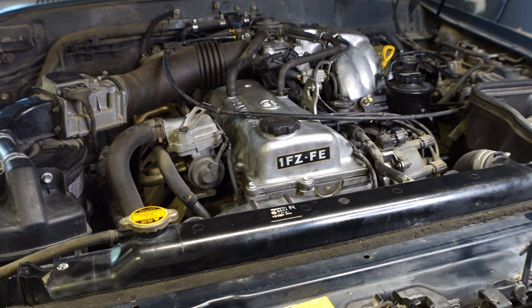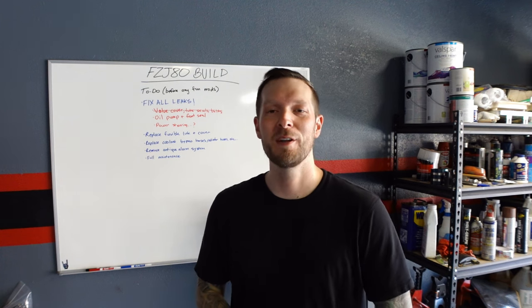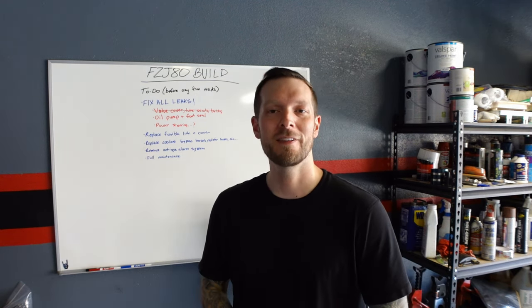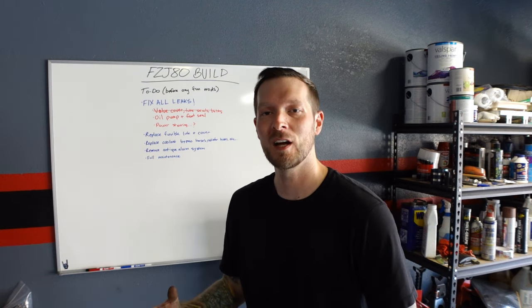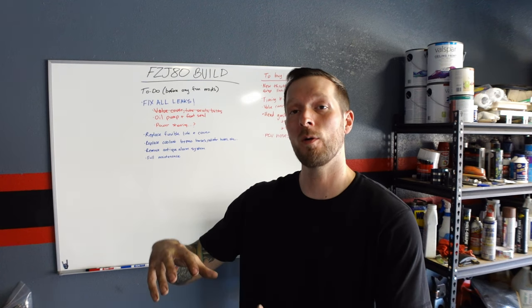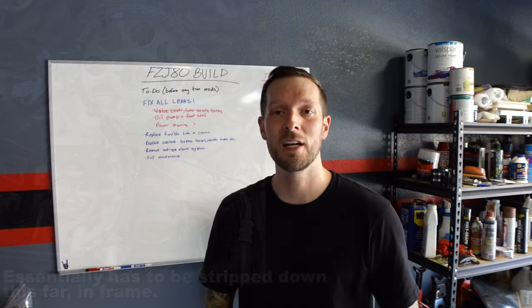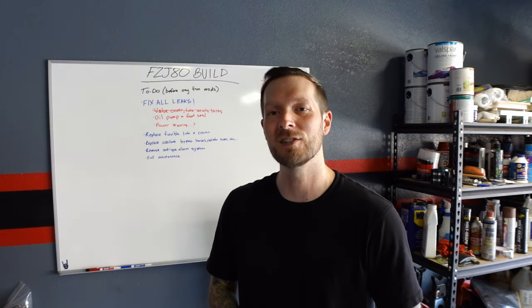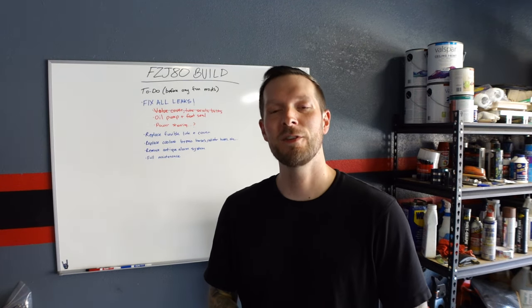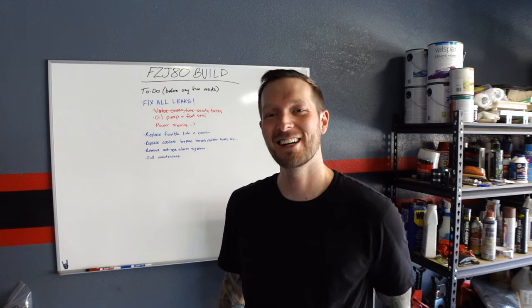Do you guys hear how quiet this engine runs? Like how perfectly smooth it is? This is why it breaks my heart that I'm going to have to tear this thing down to fix that timing chain guide. Well, that's going to wrap up today's video guys. I can't lie to you — I'm pretty bummed out that I have to tear down this entire motor. I just went in here to change a valve cover gasket and fix some leaks, and it turns out I basically have an engine rebuild on my hands. I don't have to take it out of the frame or anything, but there is a lot of work. You have to take off both of the oil pans and that involves an engine hoist lifting the engine up. I have to take off everything I just did in this video plus the cylinder head, and then I can finally get to the timing chain. So we're looking at like 30 hours of work to get this done. On the bright side, at least I can make some videos for you guys and hopefully help you out if you're having to do something similar to your own Land Cruiser — or maybe you just like watching me suffer. Either way, I'll catch you guys in the next one.